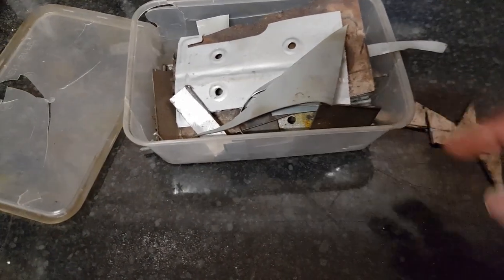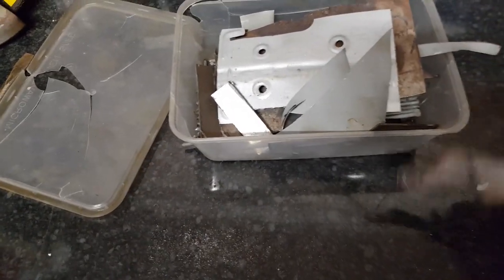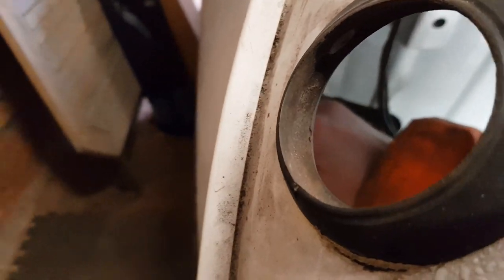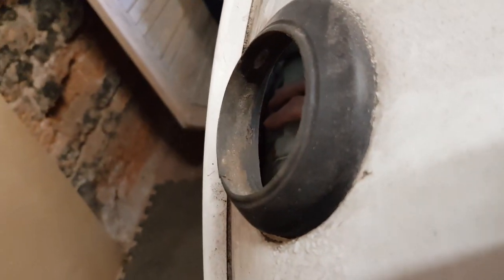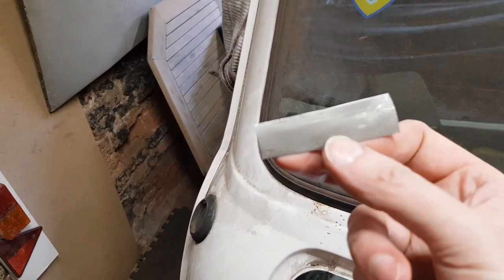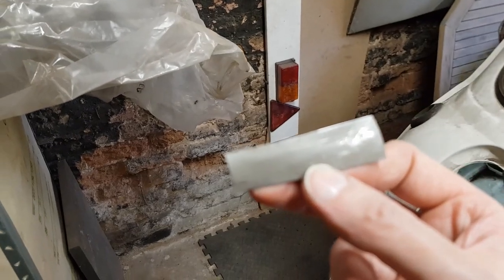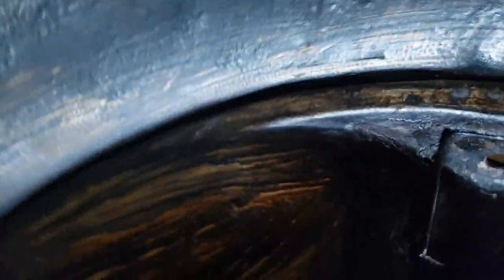When I make a panel out of zintec or steel I always keep all the offcuts because they're inevitably useful, and sure enough there's a little offcut that I've cut and shaped to form the repair patch, which goes over there. It's so tight I can barely even show you — I was peering through the fuel filler cap opening. It's only two holes but I've done a longer patch just to make it easier to weld. The patch is now welded in. You can barely see it, and the fuel tank goes there anyway. Two holes filled in with weld.